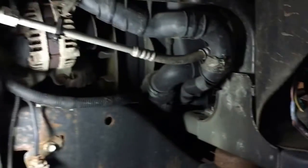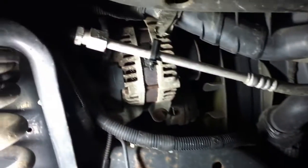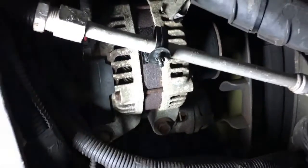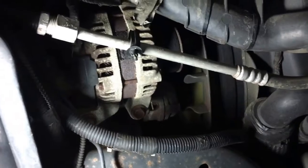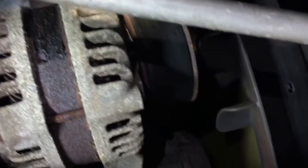There's the alternator that's going to come out. Along the fender is where those little tiny 7/32nd bolts came out of. The little plastic ones don't need to be removed — that holds in the trim work. I believe there's also an air conditioning line there that attaches into the plastic shield, so we've got to jam that back in so the AC line doesn't rattle. Now we're going to start digging at the alternator — there's a total of three bolts: two on the bottom, the electrical connections, and one up top.